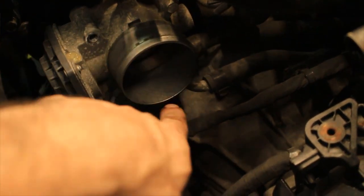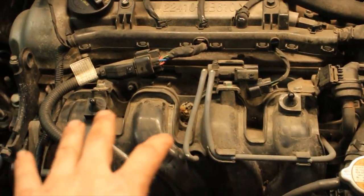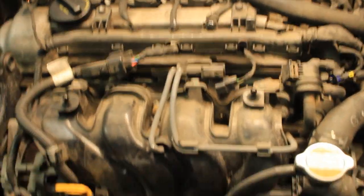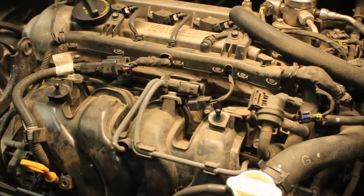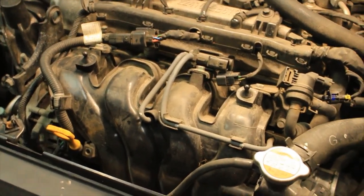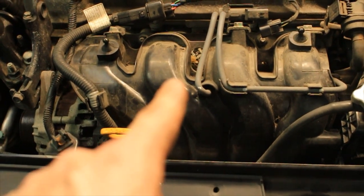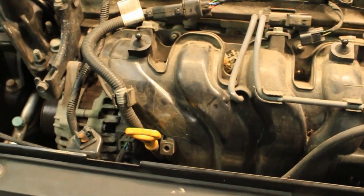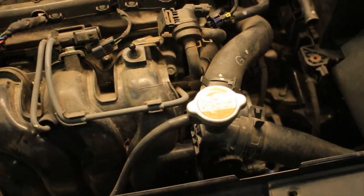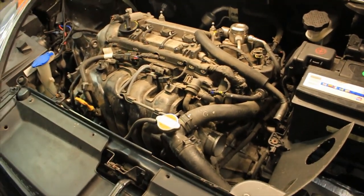The other thing I'm doing is pulling the intake manifold off. We're at almost 175K here. Yes I've done the GDI spray cleaners, but at the end of the day it doesn't matter - it's still gonna carbon up. You can run a catch can, guess what, still gonna carbon up. Book time on the manifold is about a two-hour job, so I'm gonna take the three hours it takes to pull the manifold, scrub all the intake valves, put it back together, then put the throttle body upgrade on, reset the fuel adaptations in the PCM, and go test it.